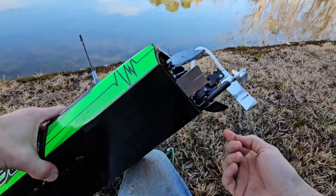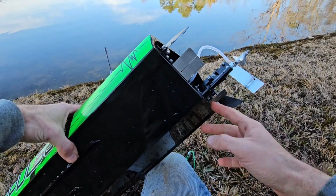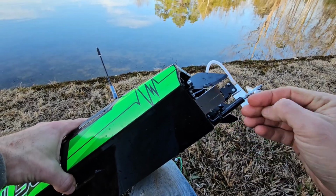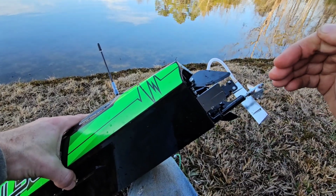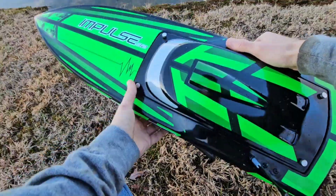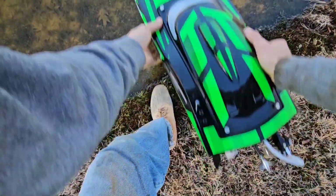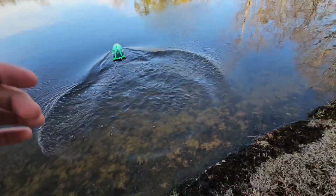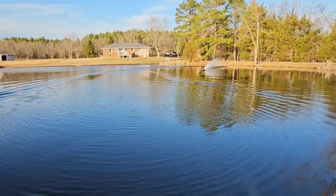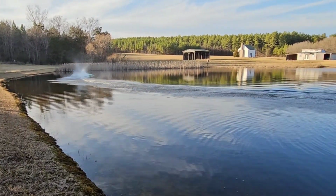Okay, so what I have done, I went ahead and did 1 revolution down on both of the trim tabs on the right hand side, and I made the rear strut dead nuts level. There's a position in there where you feel it pop, and it pops right into center, so that's where she's at now. Now that we have the rear strut neutral, we want to give that a try and see if that's going to make a difference or not. It definitely helped it.